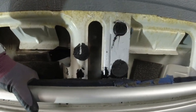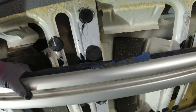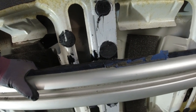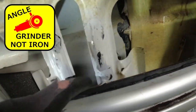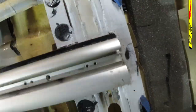I suppose to pass a bus safety inspection, these need to be really secure. So bolted and reinforced, supported, glued, screwed, bolted, welded. So these are the welds. We're going to cut these with an angle grinder, go all the way along these ones, all there, down this side, crowbar it, and see what they've welded underneath. And have a look under there as well.